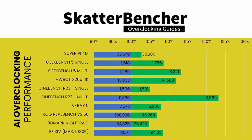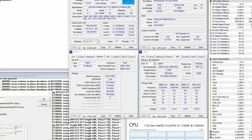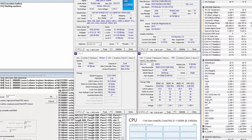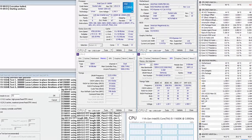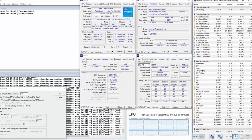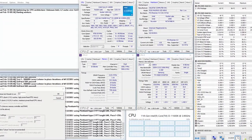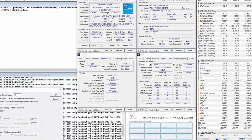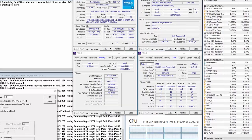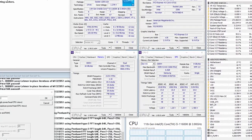We re-ran the benchmarks and checked the performance increase. Performance increases across the board; however, in all-core multi-threaded applications, performance is lower than our second overclocking strategy using the package temperature threshold, due to the lower all-core frequency. When running Prime95 Small FFTs with AVX enabled, the CPU operates stably at 4.7 GHz with 1.351V; average CPU temp is 89°C, VRM temp is 43°C, water temp is 25°C, and CPU package power is 241W. With AVX disabled, the CPU operates stably at 4.7 GHz with 1.286V; average CPU temp is 62°C, VRM temp is 39°C, water temp is 27°C, and CPU package power is 170W.